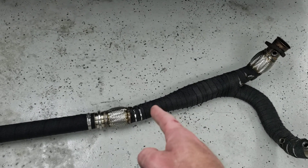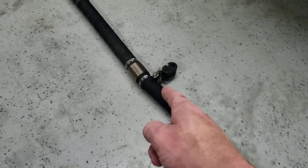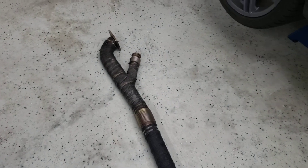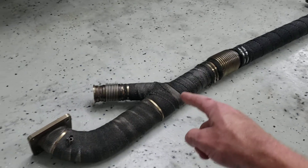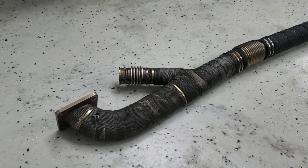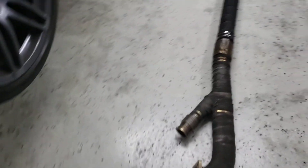The merge drops down to a single two and a half inch round, and that two and a half inch continues all the way through a V-band connection here, two and a half inch all the way down through a couple bellows, back to a little bit of oval — there's an oval transition about here, round to oval two and a half inch. This two and a half inch oval is from Spintech mufflers, so it's a slightly different shape oval, a little taller.